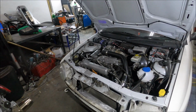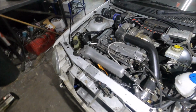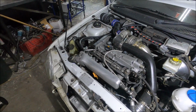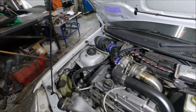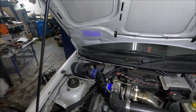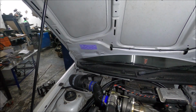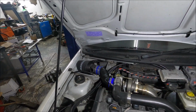It's really nice to work on, literally. Oil filter's just there. You can get your hand under there and change all the NOx sensors, everything. Inlet manifold's off in 5 minutes. Turbo's there, it comes off in minutes. Air filter's in an amazing place for not only cold air, because you've got the scuttle panel there and that's a high pressure area, but also just in front of the driver's seat. That's going to sound absolutely ridiculous.